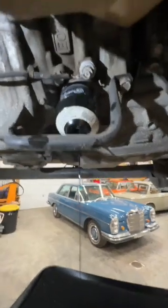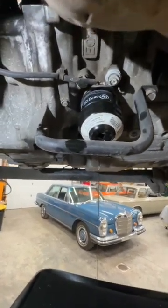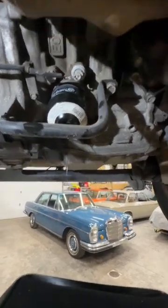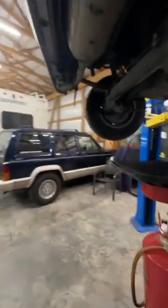So I'm gonna let this drain a little bit off. Once that stops, we'll take it off the rest of the way by hand. And then we will go ahead and get that other filter oiled up and ready. We'll show that here in a second. Also want to show, while we've got the time, we went ahead and torqued this to spec. There's that copper ring. Everything's good there, nice and tight. We'll make a mark on it just to note.